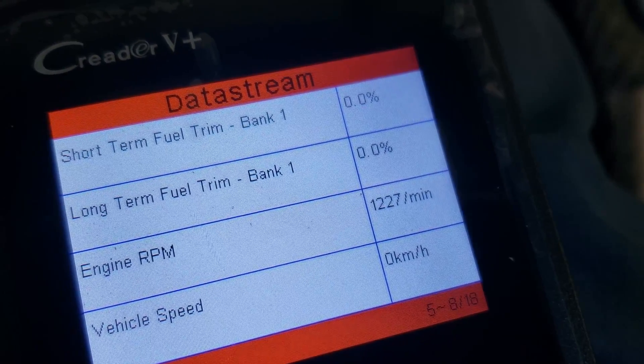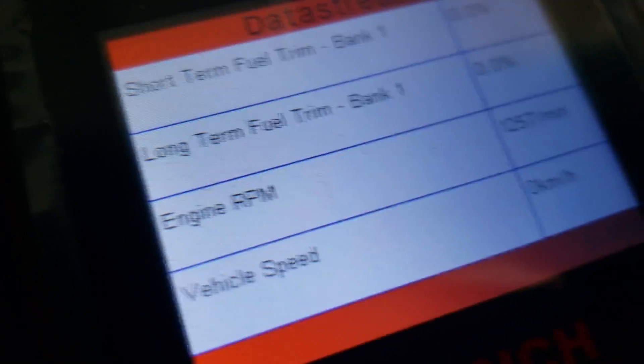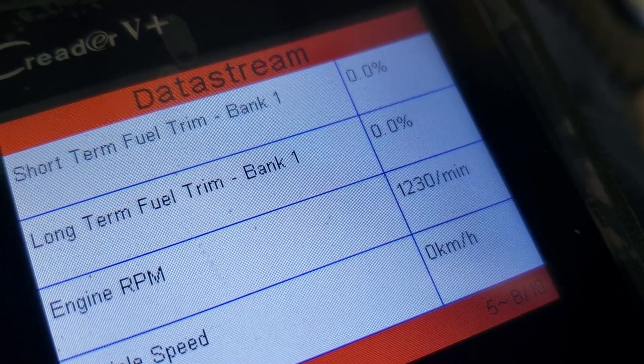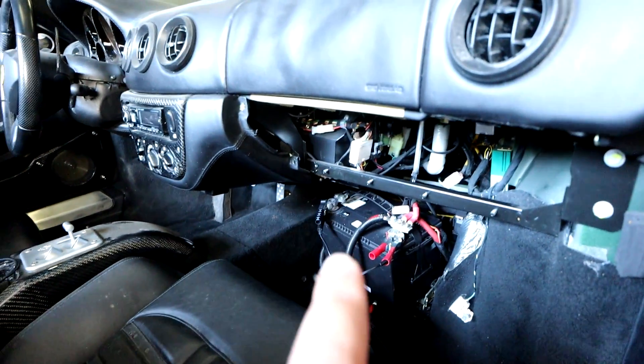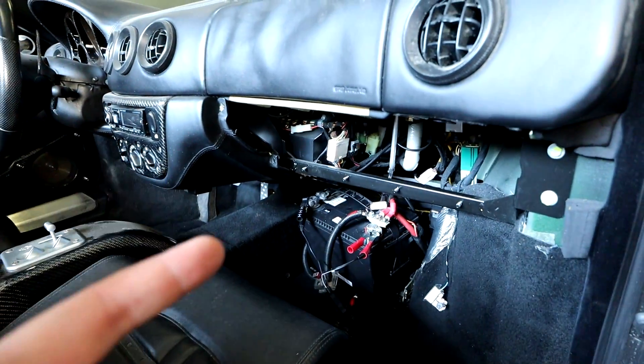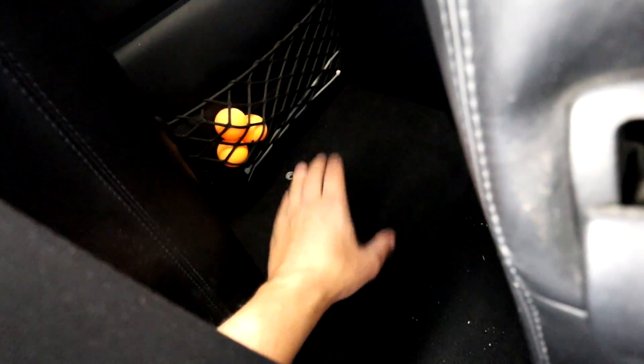While I'm no Ferrari mechanic, there's got to be an electrical communication issue somewhere. A lot of the electrical components are located behind the seats in this car, so right now is a great time to start disassembling things on the passenger side. I've already taken out that nuisance glove box that was stuck open. I'm going to disconnect the battery, take this seat out, and right back here is one of the three fuse boxes in this car. The code we got is electrical-related, so there's a chance it's just a blown fuse — although it's highly unlikely. We'll check that out once we get all of this torn apart.